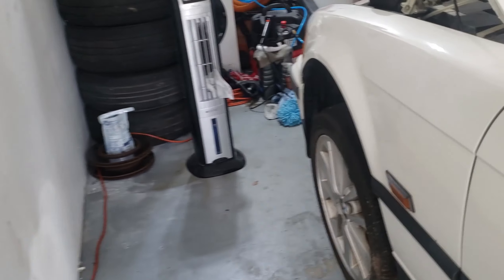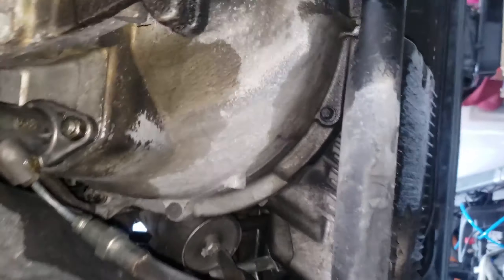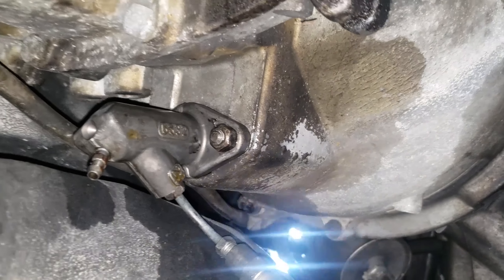In order for it to drive, I'm thinking I need to replace the clutch slave, which is down here. I'll go ahead and show you guys for those that maybe aren't familiar. That right there is the slave cylinder, the clutch slave. Without that working properly, the clutch won't disengage and re-engage. There's a rod in there similar to a brake master cylinder that'll push brake fluid in to engage or disengage a clutch. The car will go into gear fine when it's off, but with the engine running it's not disengaging, so it's only grinding. I haven't been able to drive it yet, and that's why I had to have it towed in here.